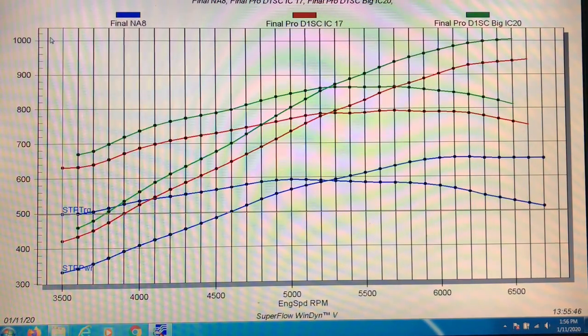Interestingly, peak torque actually occurred lower at 5,300 RPM with the bigger intercooler core. We suspect that running the D1SC at 1,000 horsepower, we're getting up near the flow limits of the supercharger. If you're going to go over 1,000 horsepower, it might be a good idea to step up from the D1SC to something like an F1A or F1A94 — then you could make some real serious power. But as this shows, stepping up in intercooler core size made a big change. We still had good cooling but we had a bunch more flow, so the intercooler has to be sized both to cool the charge air and to not restrict its flow.